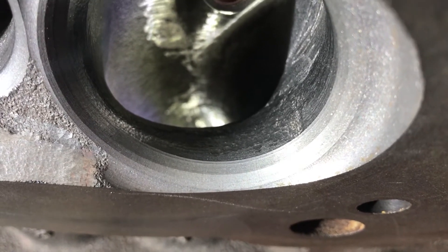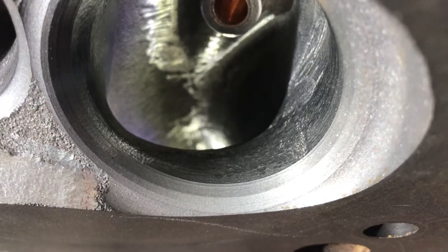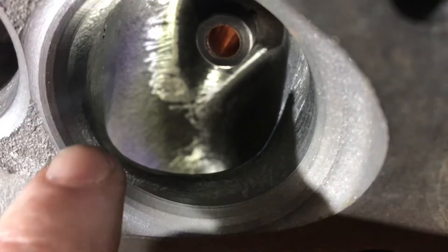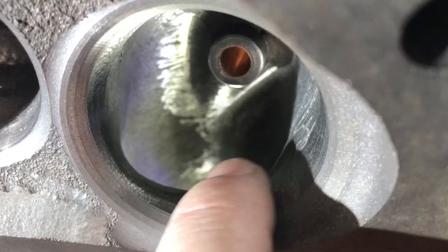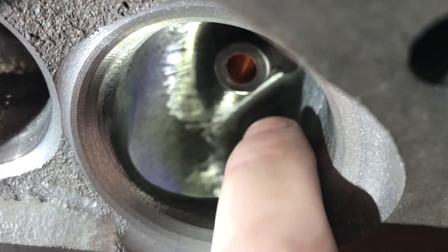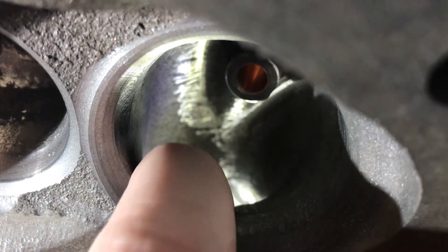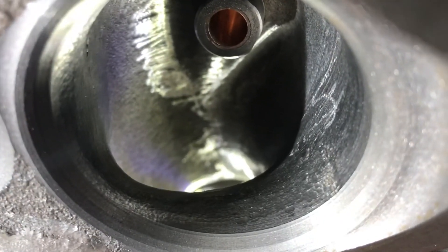The center side of the port — the cylinder side of the port — is definitely lower, and the angle is swept back flatter than the other side. The other side is high and nice and rounded, and the sides are a little narrower and flatter, then blended back into the floor of the port.